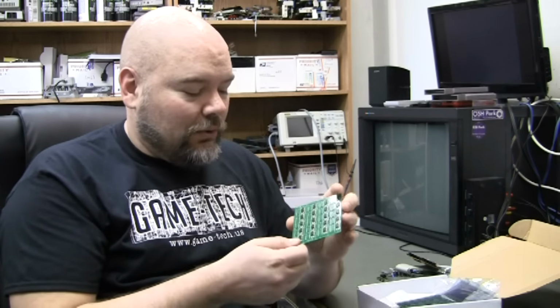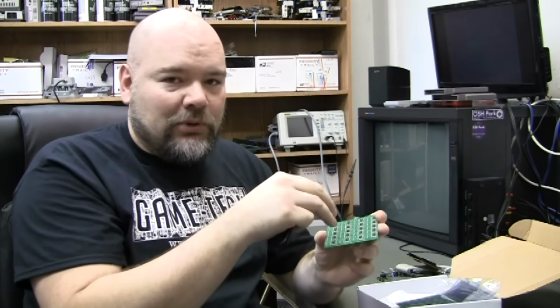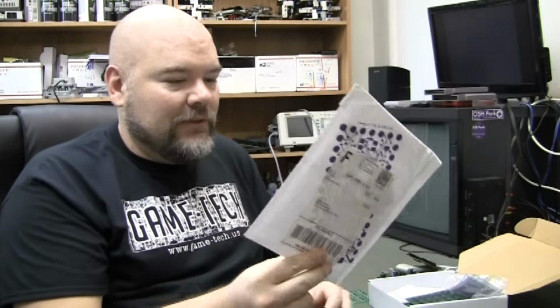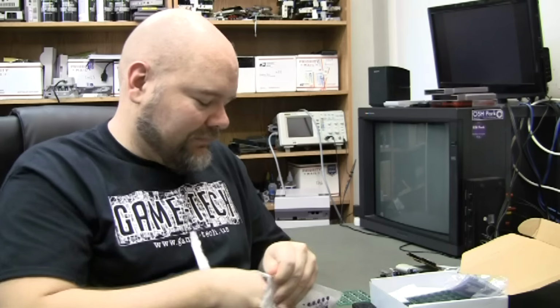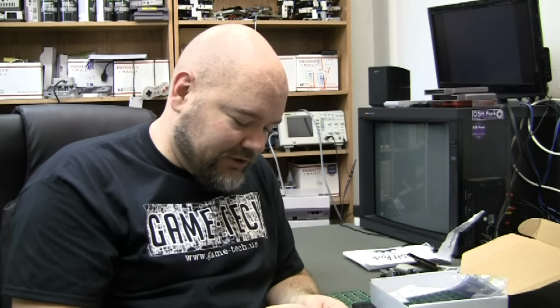And I ended up making a whole separate board that's basically the same pins and whatnot, but it doesn't have the chip on it. And I'm going to take this and solder pogo pins to it and just do it from the top like that. And that way I can just lay it down and bam, bam, bam, bam. So that board I had made through OSH Park. Still pretty fast, extremely cheap for what you're getting. I think I only paid like $4 for three of these tiny little boards. Free shipping, you know, and their purple solder mask and the ENIG finish.